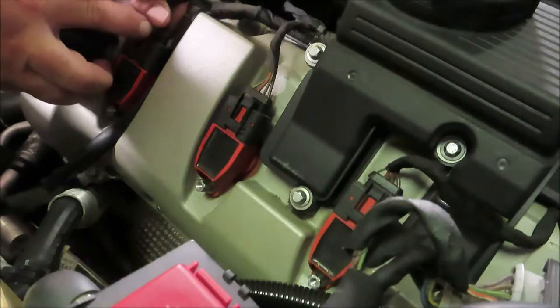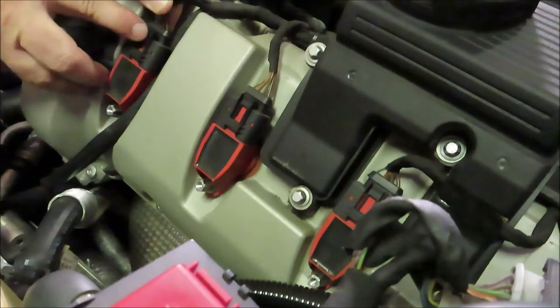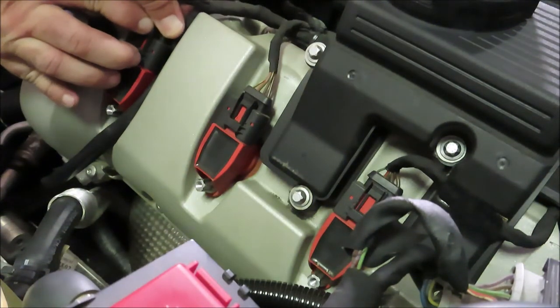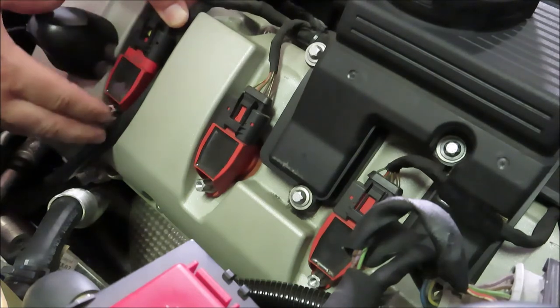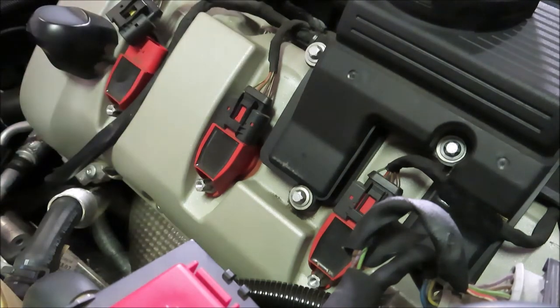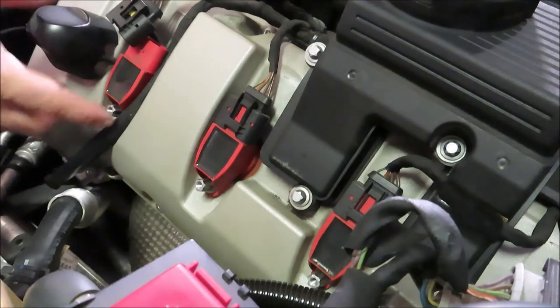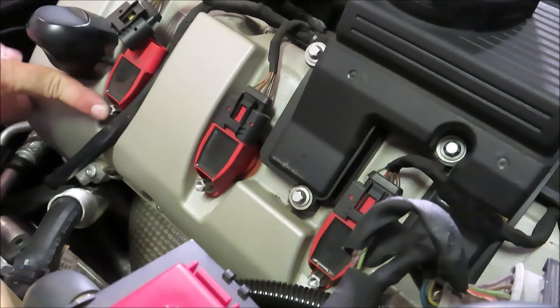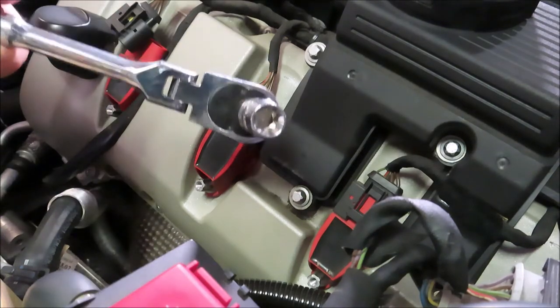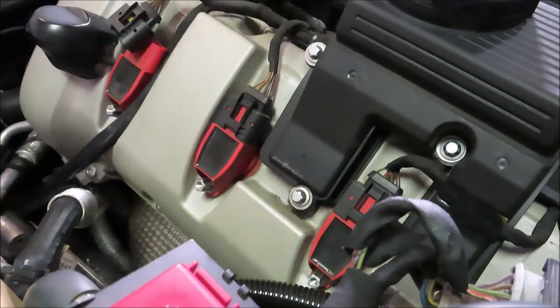Go ahead and remove the plugs, but be very careful with the clips. Mark it up there. All right. Next, we got these, I guess they're kind of screws. They take an external Torx. It's like an E12, it's called.